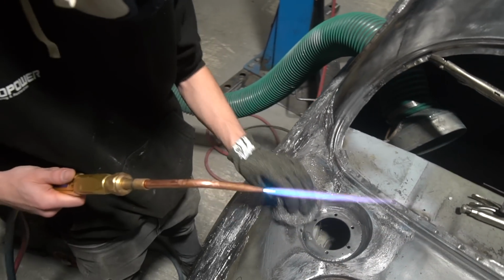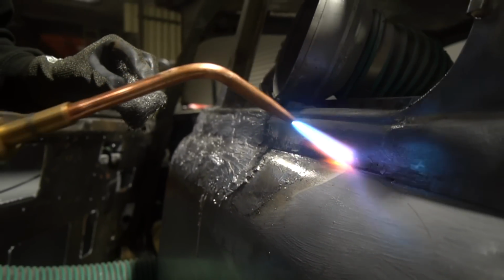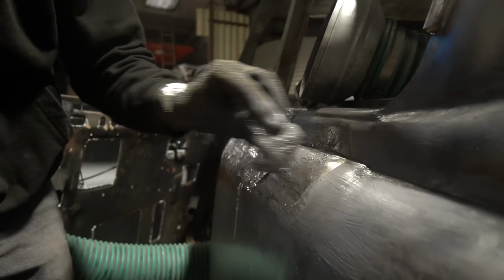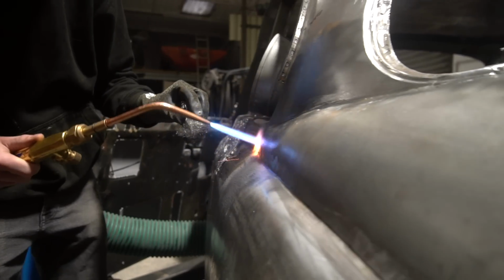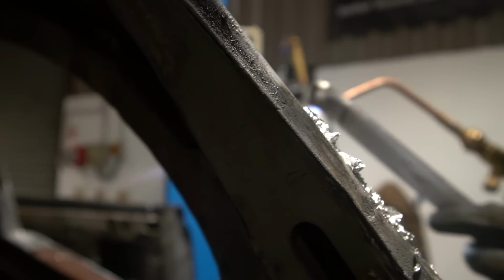So, yeah, you basically use the wire wool to abrade the surface, ensuring that the surface is wetted with lead. And once the surface is completely wetted with lead, or tinned as we would say, then from that point you can make further lead stick to that.